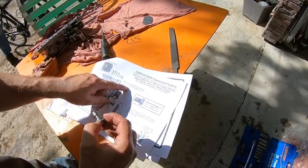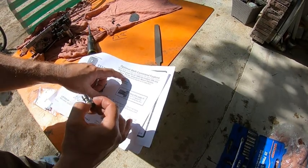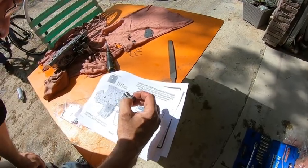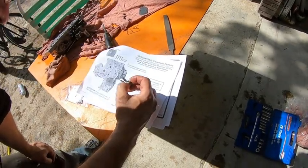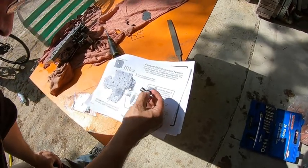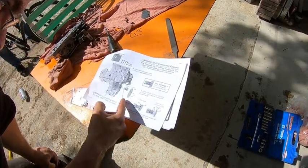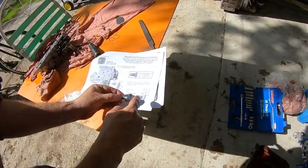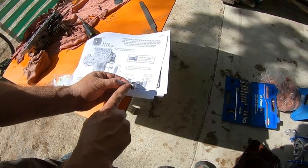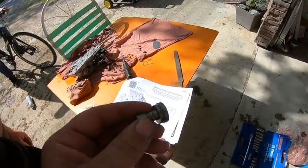Optional shift command allows you to manually shift to low gear at any speed. Okay. Skip this page if your governor valve looks like that. Well, my governor does not look like that, so we have to make it look like that. So it says grind a bevel, get rid of this, and grind it off. Do you want a radius in it? Yeah.